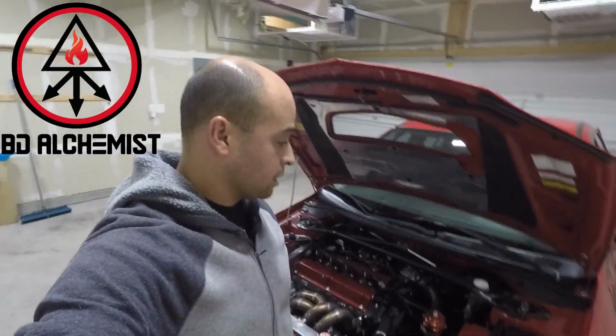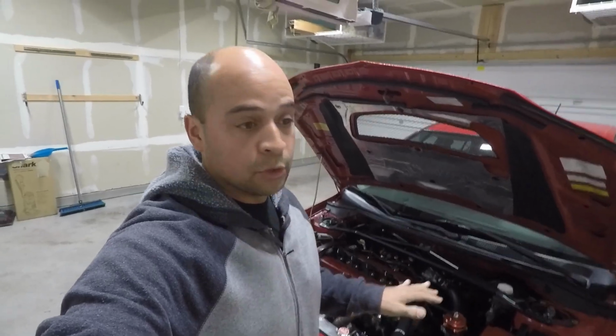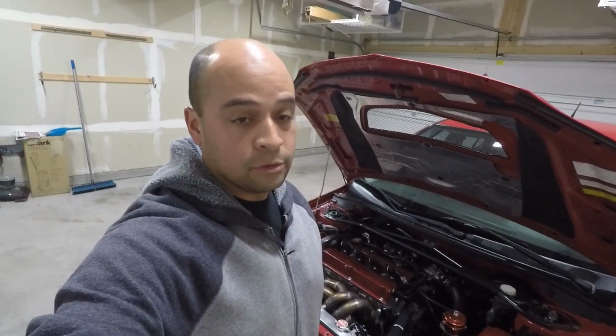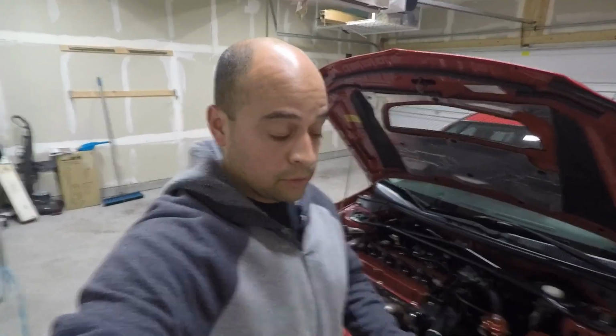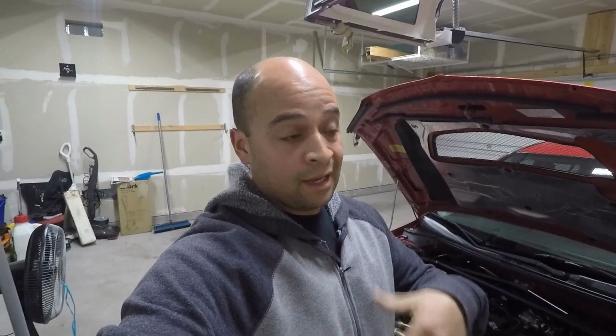Alright guys, so we're going to go back at this again. Last video you guys saw that the car was still boosting at 24.5, 25 psi. So we're going to take the wastegates off, pull the springs, but before we do that I'm going to put compressed air into them with a regulator to see what psi they start to crack open, and then to see what psi they're actually fully open.